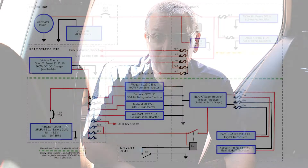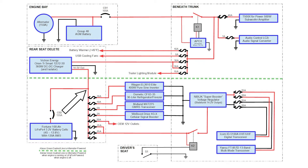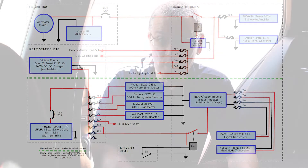Another leech for charging current is the electrical output to my equipment — it's between the lithium battery and the charger, so any power my equipment is using takes away from the charging current reaching the battery. If my transceivers, Raspberry Pi, and dash cam are running — which they usually are — that's about two to three amps not going to the BMS to charge the lithium battery. Make that six amps if I've got my refrigerator in here and it's running. And if I key up my ham radio, that's 12 amps transmitting on VHF or UHF, and 22 amps on HF. So that takes away from everything.